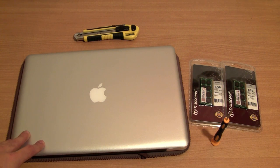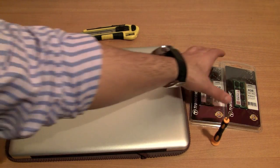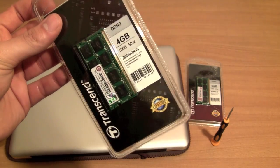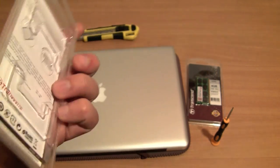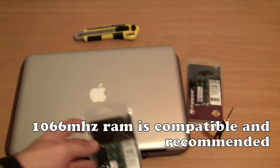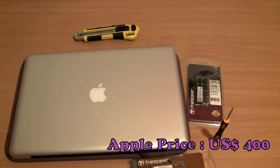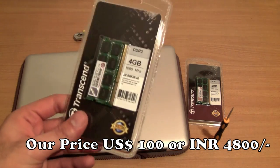Today we're going to be upgrading the RAM in my 15-inch MacBook Pro from 4GB to 8GB, and we're using Transcend DDR3 RAM, which is a 4GB slot, 1066MHz RAM, which is compatible with the MacBook. Apple charges a large sum of money to do this upgrade from 4GB to 8GB. And it's only going to cost us about $100, about 5,000 rupees to insert two slots of 4GB RAM each